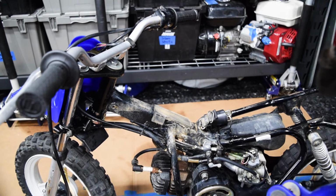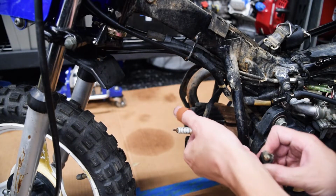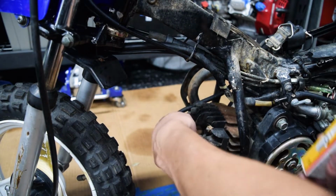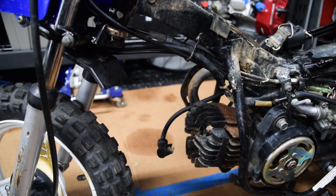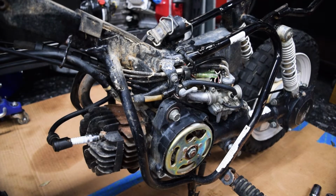There is varnish in it, but it's like gelled, so it doesn't really go anywhere. I didn't check for spark yet. I didn't realize this plug is broken. Well, I'll probably swap that one out. Using a BPR4HS, so I'll pull it out. Looks just as bad as it did the first time I took it out. I'm gonna say it's fine, until I can actually confirm it later.